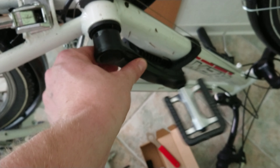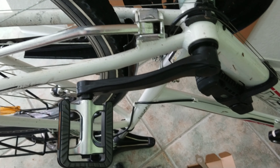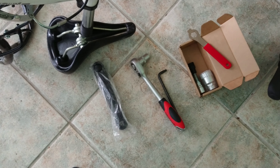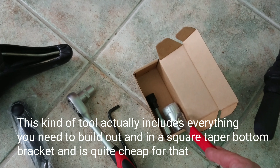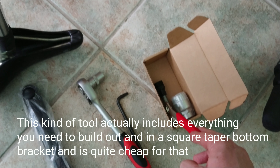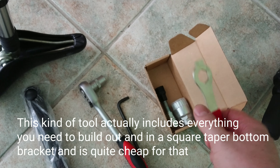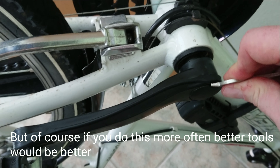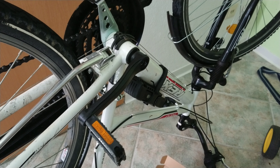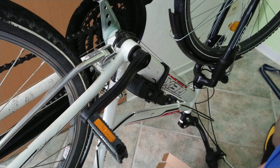You may have heard my complaints about bending this crankshaft - this crank. It's a bit hard to see, but it's not running straight anymore, so I really have to pull it and remove it. As tools, we need the new crank of course, something to open the holding screw. In this case I have a combination tool which also would allow us to open the gearbox, but we won't need that today. We also have the puller for the crank, which comes with its own key, and we can use this edge here to open the protection cap which is protecting the screw.